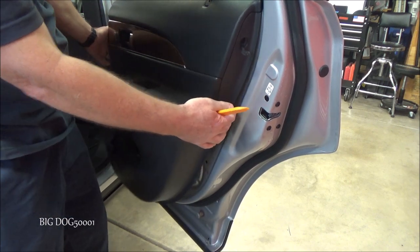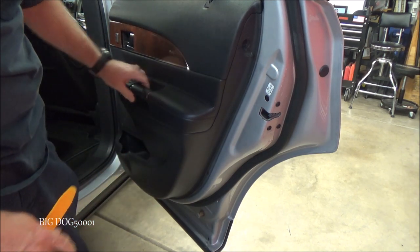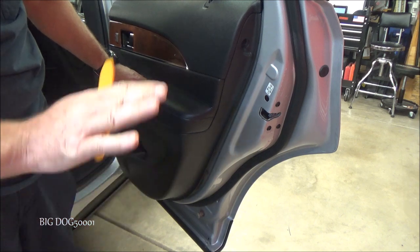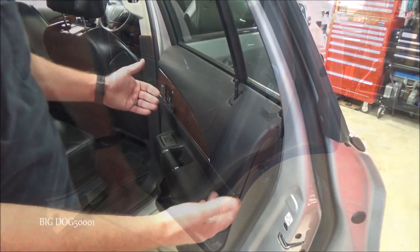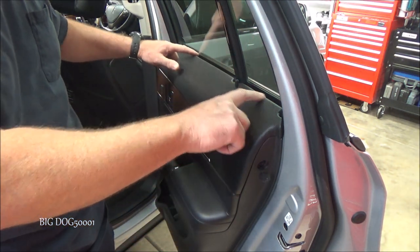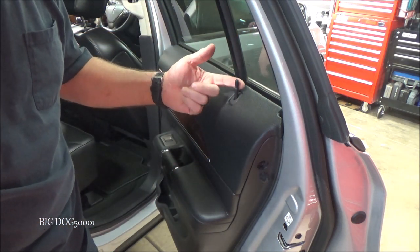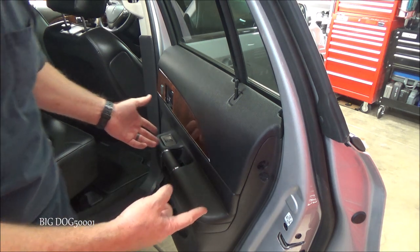There — now you can see our door panel is loose. If you feel resistance after that, especially right in the middle, if something feels like it's still holding on, stop and find the hidden screw. Now that it's loose we should be able to just pick it up — it should just be hanging on the top — we've got to get it up and over our door lock knob, and then we'll have to contend with all the electrical connectors behind there.